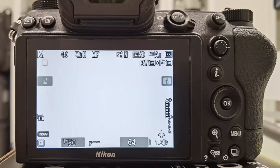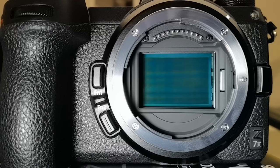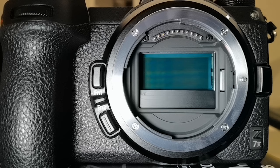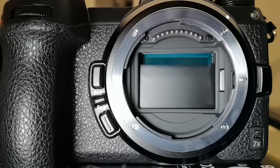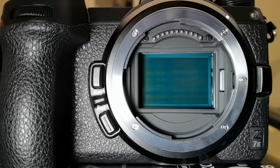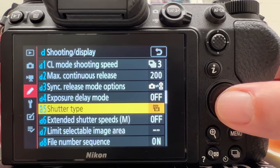I removed the lens and set a shutter speed of 1/50 second. The slow motion was recorded with one of my smartphones at 256× slowdown, so only 720p — apologies for the quality. When you switch on the camera, the sensor is activated so you can see a live view. When I push the shutter button, the front curtain closes and the camera is ready to record. The front curtain then opens and exposes the sensor to light for 1/50 second, then the rear curtain closes and ends the exposure.